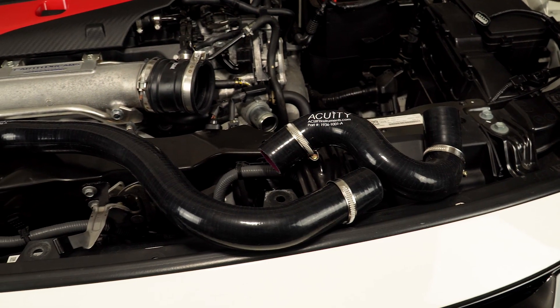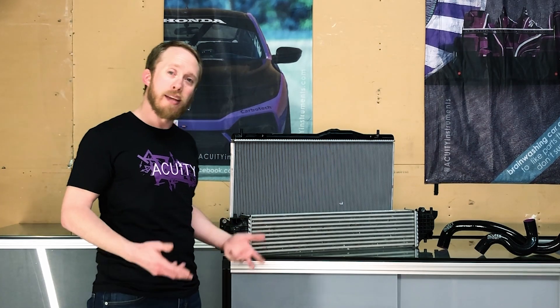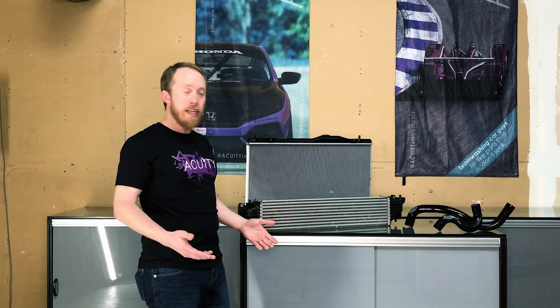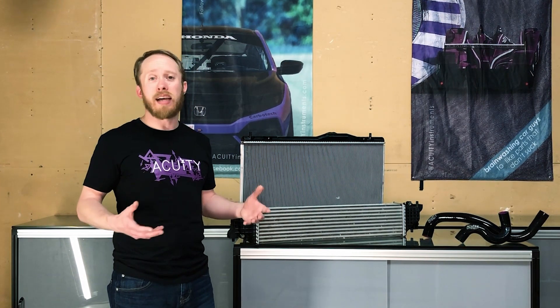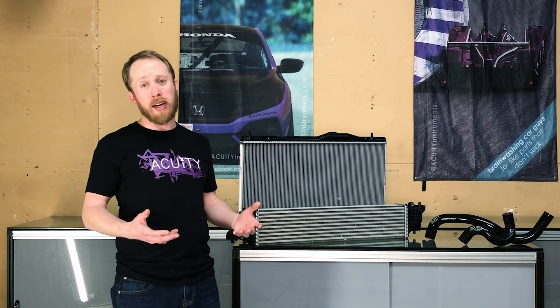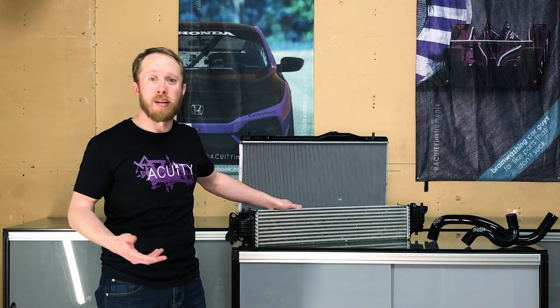So the question is: how did we design radiator hoses that actually help the car cool better? What we did was change the direction that water flows through the radiator. In stock format, the FK8 flows hot water into the top of the radiator, which travels down to the bottom and exits back to the engine. The problem is that hot water enters the top where cool air comes in, and the cold water exits the bottom where hot air enters — this is thermally backwards from an ideal heat exchanger setup. An aftermarket intercooler can make the problem even worse: since they're designed to extract more heat from the charge air, that heat goes into the cooling air, meaning air exiting an upgraded intercooler is even hotter than with a stock unit, making the air entering the bottom of the radiator even hotter.